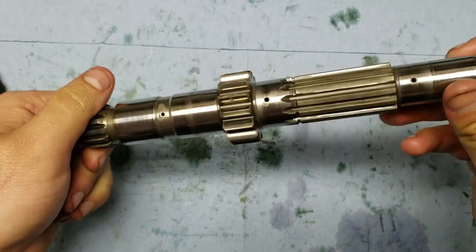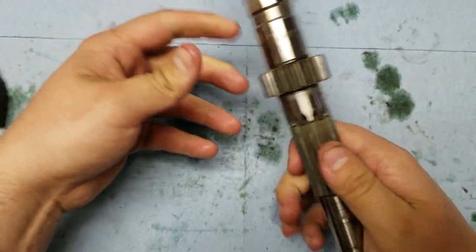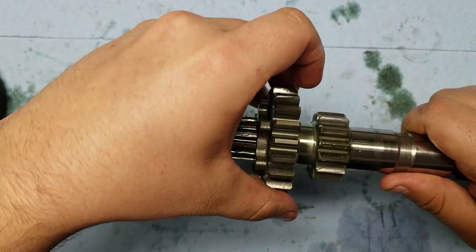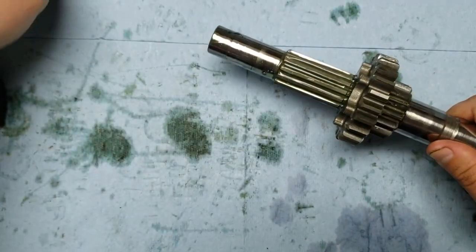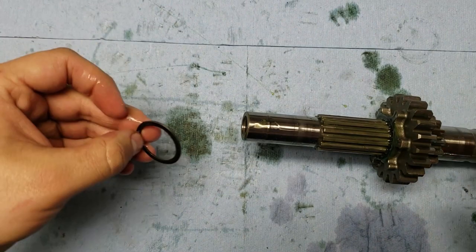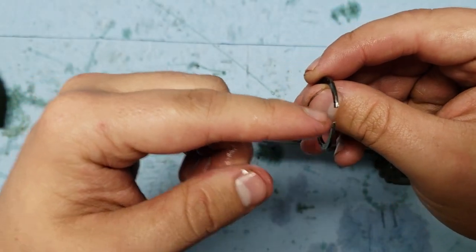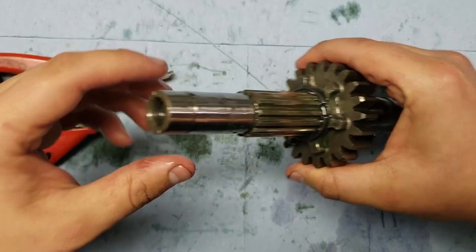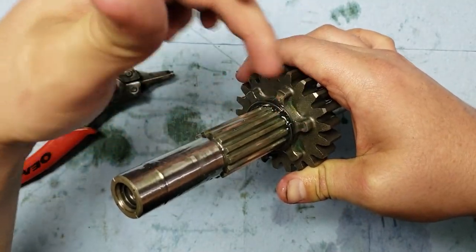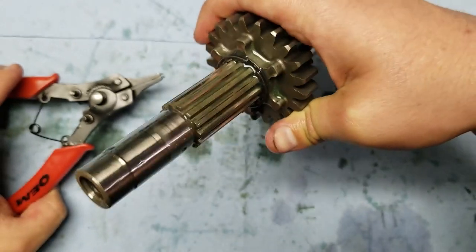Now I'm going to go ahead and get this thing cleaned up — make sure all the journals are free, all the splines are good, and I'm going to make sure I clean off all the gears as well. The main axle is all cleaned up, all the journals are blown out, all the splines are nice and clean. I'm going to go ahead and put some assembly lube on it and start putting this back together. Starting off the fifth pinion gear — just going to go ahead and roll this on here just like so. Make sure it turns really good. Then the tooth washer. Then the circlip — which again follows the same rule: the sharp end goes on the opposite side of wherever the tooth washer is. You still want to attempt to get the ends inside the splines — that's about the best I can get with both just barely inside the splines.